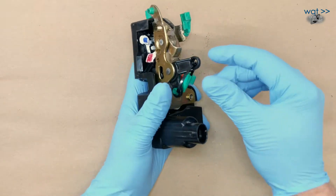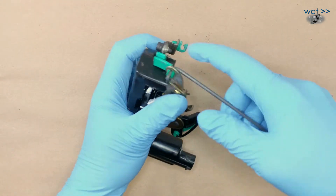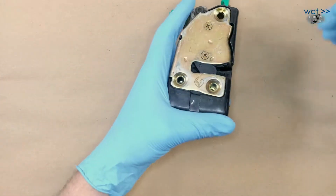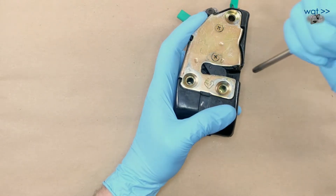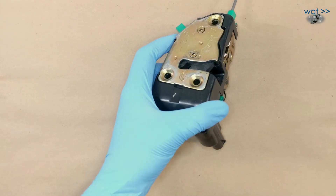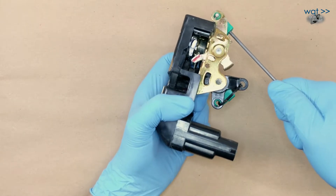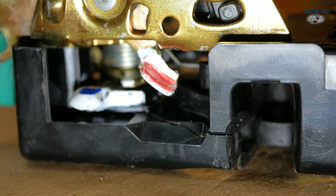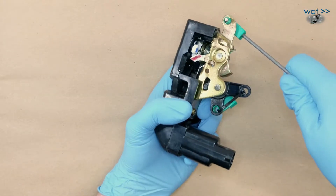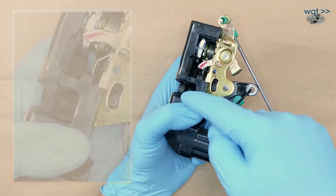Let's take a quick look at how this works. We're currently unlocked and sitting inside the vehicle. I'll go ahead and put a door rod in here for fun, with the door closed. This lever here, which is kind of U-shaped, goes in like that — that is the fully latched position. You reach for the door handle and pull it. See that little red tab coming up to hit that little blue one? That is what is going to open the door — it throws this whole assembly, which is spring-loaded down in there. The door latch just sprung open there.